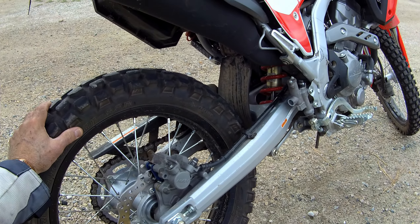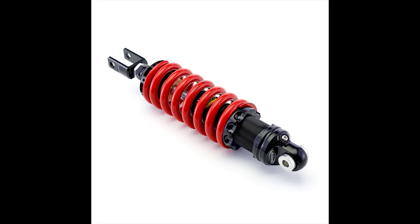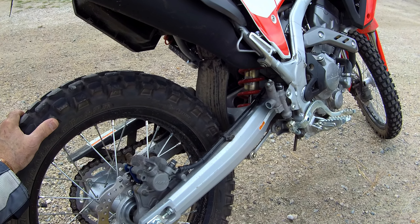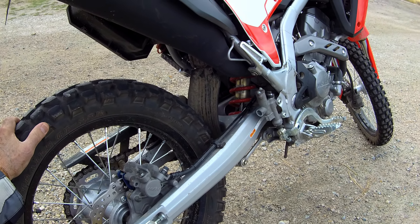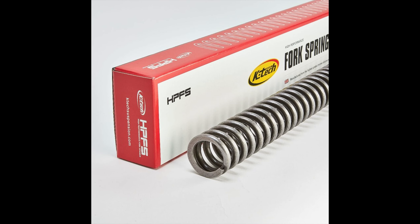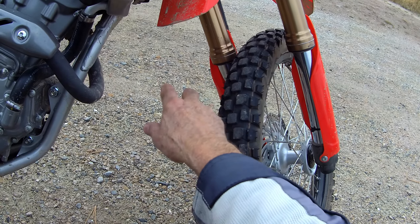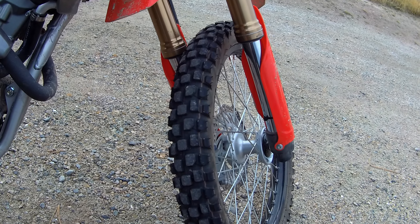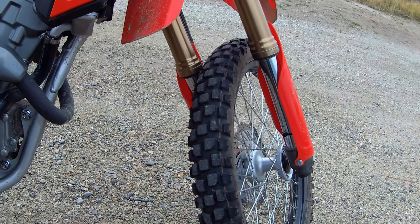The shock I chose is a KTEC, KTEC Razer R Lite, made in the UK. I ordered it from KTEC in the States, or Orient Express, I think they're also called. Same place. I also ordered the replacement spring for the fork leg. Unlike the 250L, like from Racetech or whatever, where they had a separate spring and the other leg, KTEC just supplies a stiffer spring for the leg that has the spring — I think it's the right leg. They have different options. I chose 15% stiffer than stock.